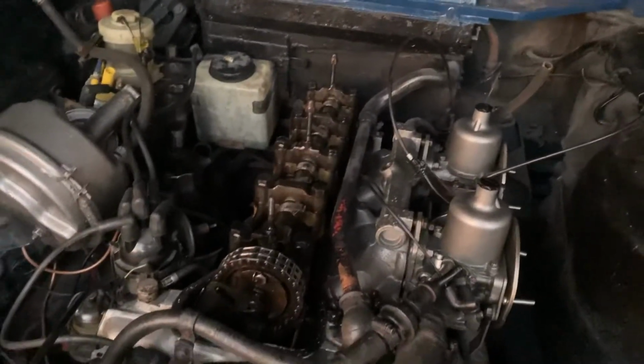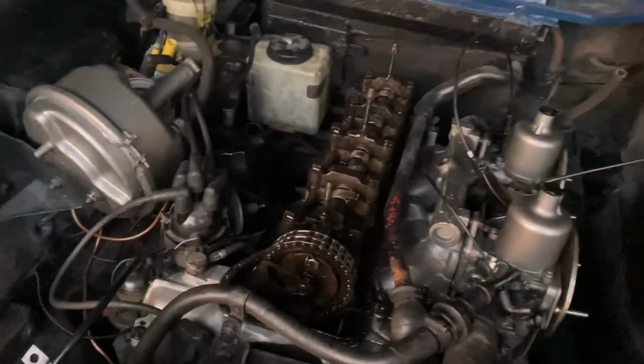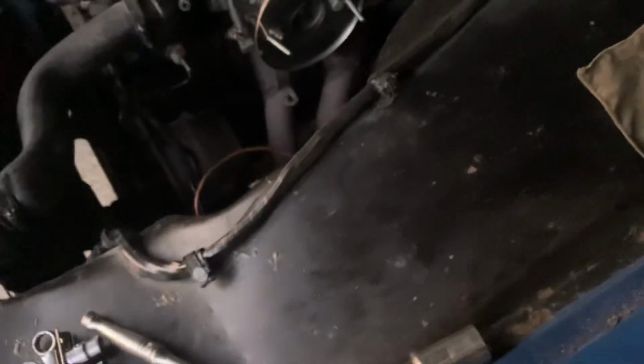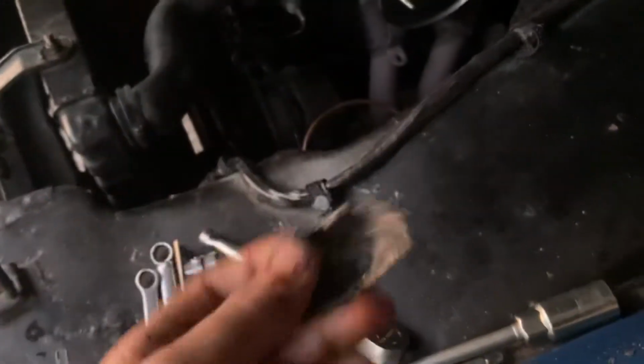But yeah, obviously, when there's good news, there's always bad news. The bad news is I noticed a little bit of what looked like fiberglass filler over on the opposite side. This side's kind of alright up there and along here, and I thought, oh, they just skimmed over a little bit of rust. Yeah, it was a little bit of rust at one point, but this plate was welded over a hole. As you can see, that's quite rusty on the back half. That plate was stuck over some rust about there where that rag is. So yeah, it's not too good. I just saw that and it was all black paint, and I thought, oh, a little shoddy MOT patch, but it doesn't look to be too bad under there. Just put that back.